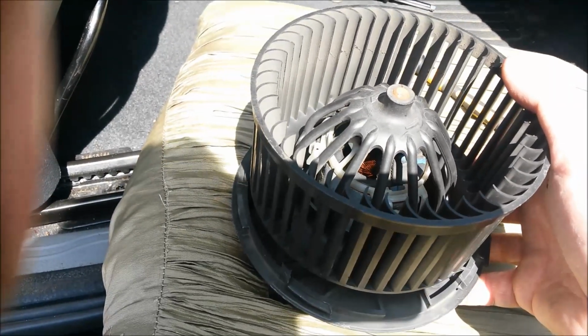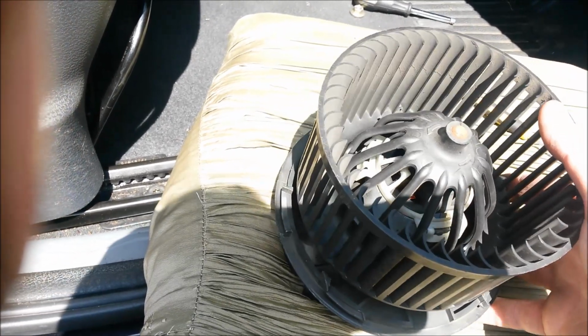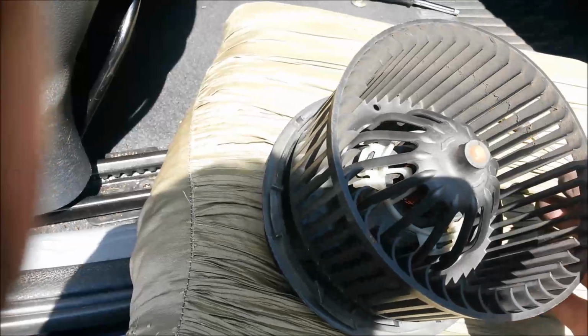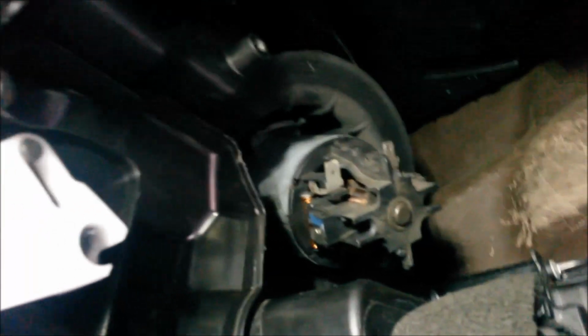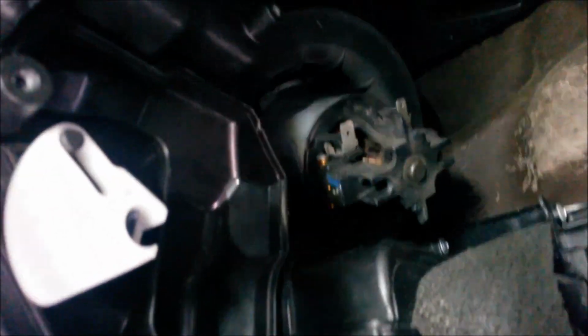And again, that is in situ, so it's a bit tricky. You have to rotate the fan in and out of the airbox just to make sure. And I'm just going to strip this one down and put it in. Okay, just have a look up there now. You see that assembly. The fan is in the airbox. You've manoeuvred it in very carefully so you don't break the fan impeller. It's a very delicate polypropylene part. So you have to be very careful manoeuvring it into situ there.